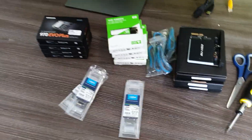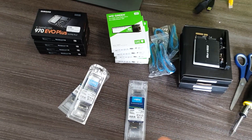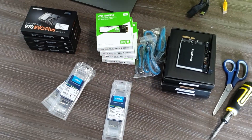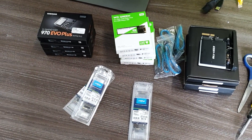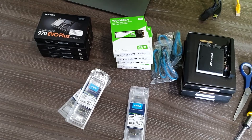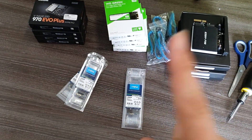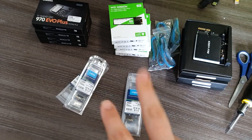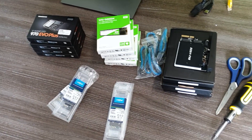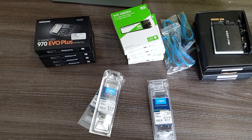At the moment the big Xeon host has a couple of terabytes - one NVMe drive and two SATA SSDs - however there's no redundancy. So I have 12 SSDs here. What we're going to do today is put a ton of storage into the Intel host. We've got two, well three, storage tiers, hence the three different types of drive. Once I'm happy this is working I'm going to buy the same set of drives again to create a second host, then have them work as a SAN on two VM hosts, and after that move into dedicated SAN hosts. One step at a time though. Everything's going to be ZFS but with a number of different pools.